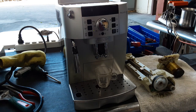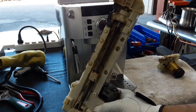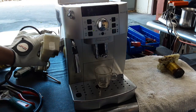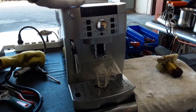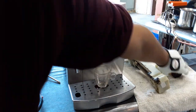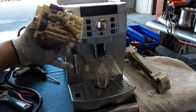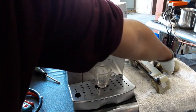For this machine we did a lot of work since we had to replace the entire transmission of this beautiful DeLonghi Magnifica. It sits right in this position inside the machine, really attached between this part of the frame and this side of the frame, so it's really hard to get out. Once we got it out, we also noticed that the mechanical valve — this one you can see right here — was leaking a lot of coffee and had a lot of buildup, so we replaced that as well.